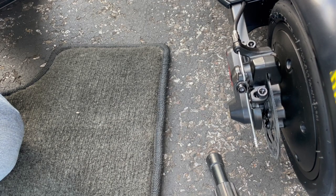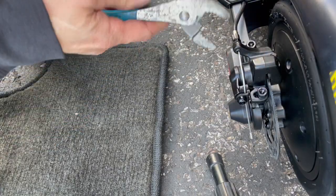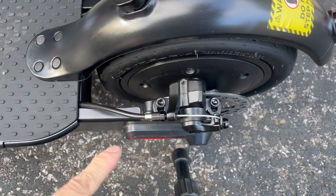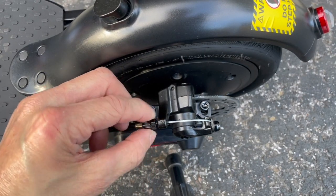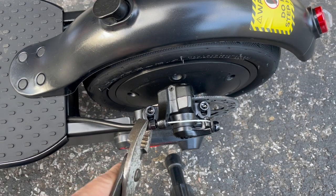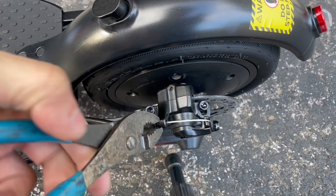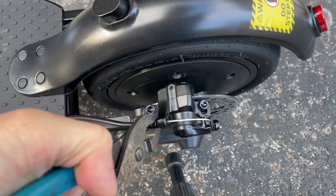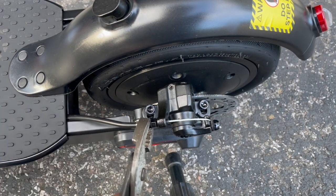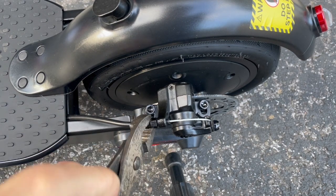So I have a lot of slop right now — my brake lever is basically touching the grip. There's too much slop there because I took up the slop at the caliper. I'm going to take up the slop at the nut here as well. See there's a lot of space there? If I turn this nut, this is what you adjust when the brake pads wear — you take up the slack. Because as it wears, there's more slack. So this thing's had all the slack taken up, so I'm going to give it back more slack and take up the wire instead.